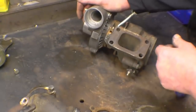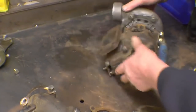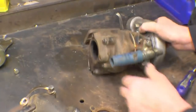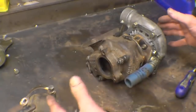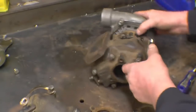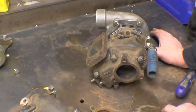It's going to be a good project — loads to do engineering-wise: things to weld, things to make, some electronics, ignition circuits. It will make a nice little compact jet engine. I didn't want a big turbocharger because then you need a big burner can, a big oil pump — it just goes on and on. This size I'll be able to pick up and carry in and out of the workshop.